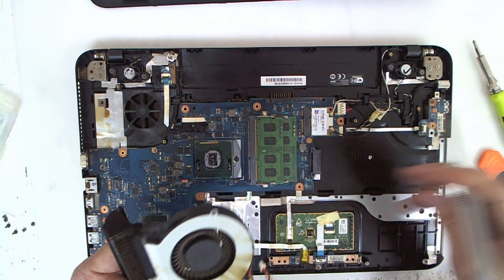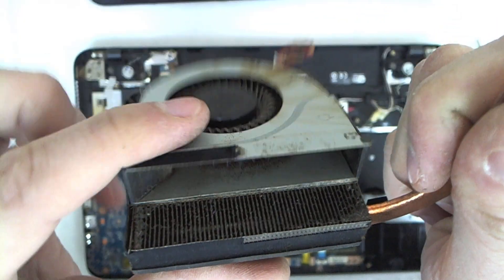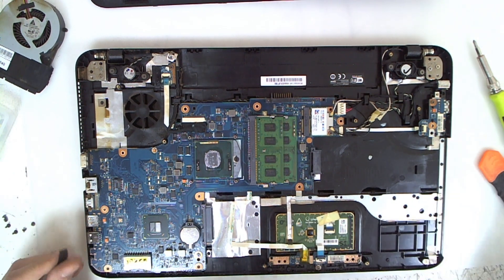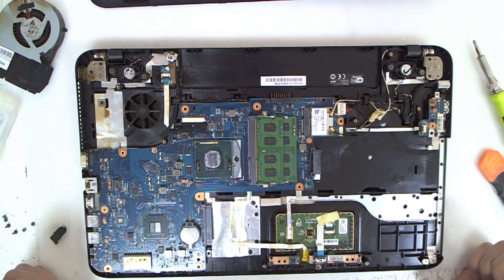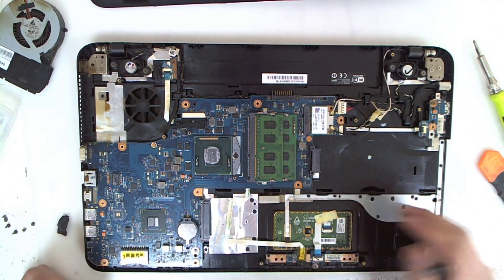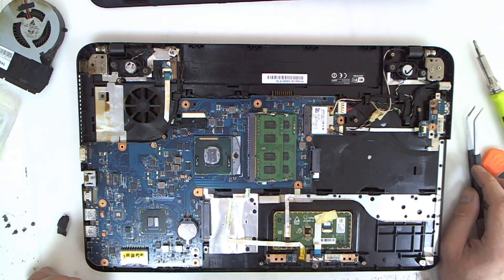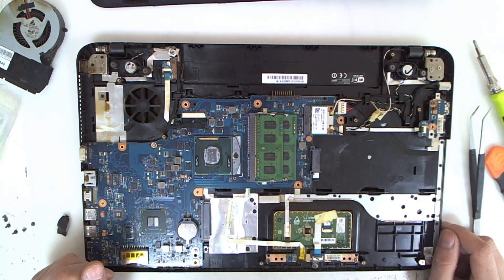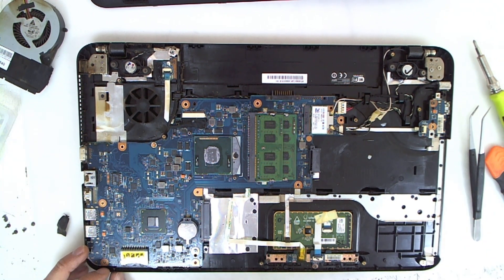It's quite clean actually. You can see the fan inside — it's quite dusty and the thermal paste is quite old, so we're gonna clean everything and replace the thermal paste. I'll stop the video now because I gotta clean the CPU — that's the boring thing. After that you just apply the new paste, put the screws back on the cooler, put the bottom cover in place, put all the screws back, and basically that's the whole thing. Hope you like the video — like and subscribe if you do. Bye bye for now.